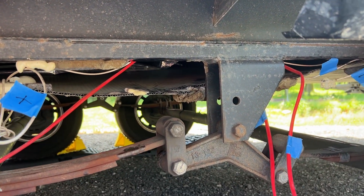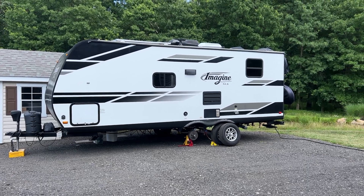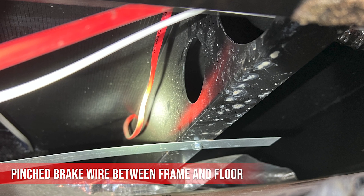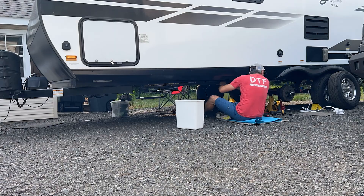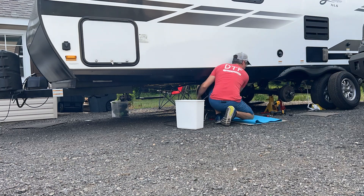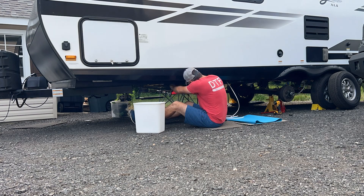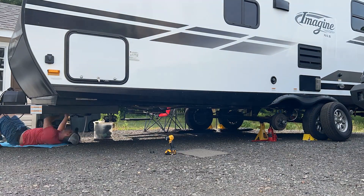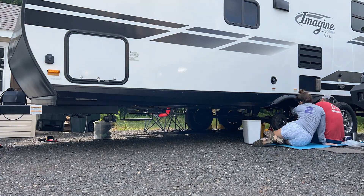We've got a new brake line on order on the way — should arrive in a couple of days. We got the new electrical cable in and I'm going to be pulling new 10-gauge duplex wire for our brakes. Hopefully this solves our problem with losing our trailer brakes, which you kind of need. I've got my wire fish, starting back here at the brakes, and I'm just going to start pulling them forward towards the front and connect it in the J-Box where the existing brake lines connect right now — just a little bit at a time, working my way down.